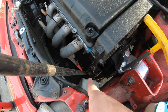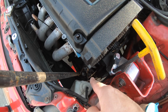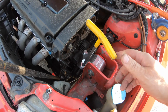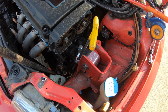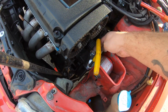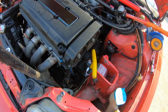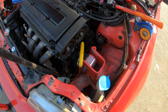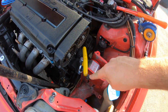Then I used a pipe all the way down by the cross member here, or whatever, the front core support, whatever you want to call it, and the oil pan or edge of the block. I kind of just pried it, and then I got my Allen wrench in here. Since I didn't have a heel bar, pry bar, whatever you want to call it, that's what I used to kind of line everything up, and I kind of just reefed this over to where I could get this guy in. Now I think I can get the last bolt in with the nylock on there, and I can semi-tighten this stuff down and start on the next one over there. But anyway, that's just an update, and that's the way I recommend doing it. Put the long bolt in first. Okay, just an update.